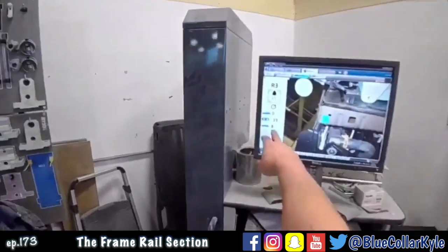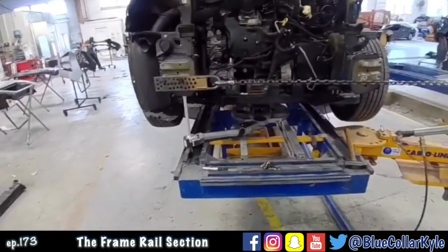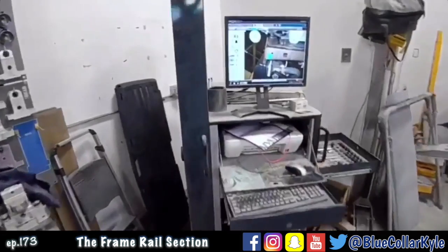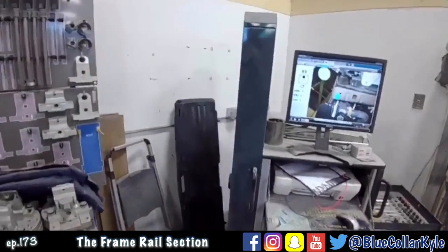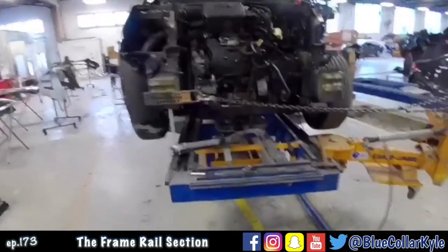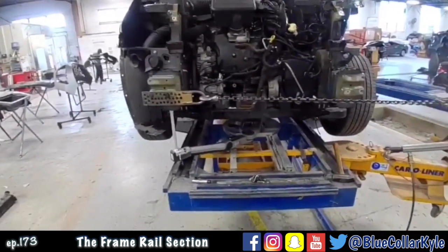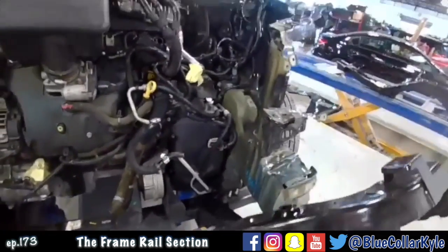Now I've over pulled it 19 millimeters, and that should get me pretty close this time. Now we're at a +3. I'm going to try to get just another millimeter out of it if I can. Should be good. Alright, I got this one all squared up. I'm going to go ahead and start cutting it apart.